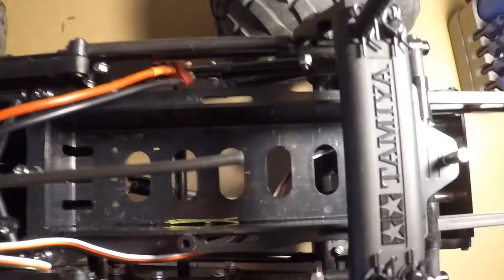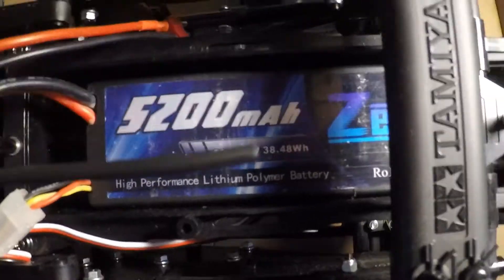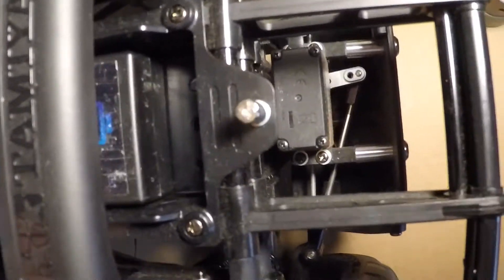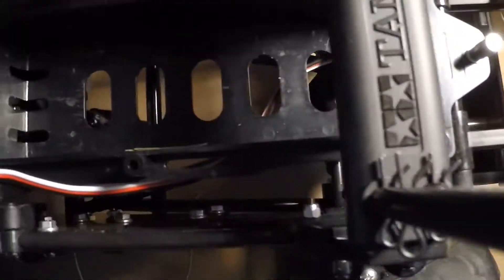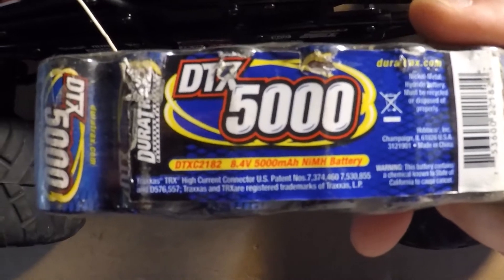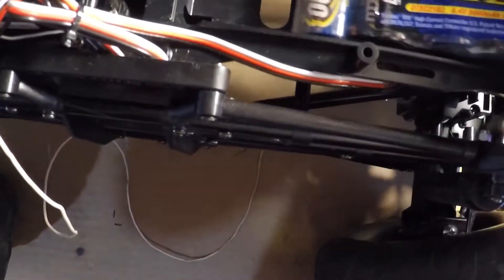The reason I say that is for the battery box itself — I'm using a 7.4 volt 5200 milliamp pack. It does have a lot of room and the battery will move around, so some sort of foam spacer in there is going to help. The battery box is quite huge, and I also have this old Duratrax 5000 milliamp 7.2 volt nickel metal hydride — it's a 7-cell battery pack — and the design of it makes it a tight fit.